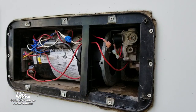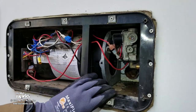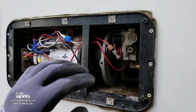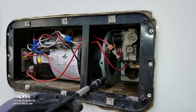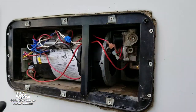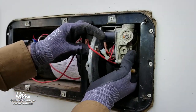I do hear a little bit of hissing — the trick there is to go inside and turn your stove on until it bleeds itself out, or just let it bleed out right here. Now I've got three screws: one on top, one below it, and one down here. Those three screws come off and this whole thing comes out. I've got an extension — that's a quarter-inch drive. So I've got my three screws out, my gas nut loose, and my exhaust port out. This whole assembly should slide right out.